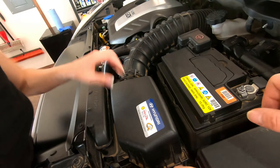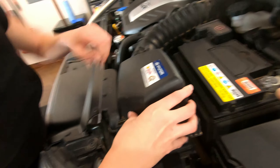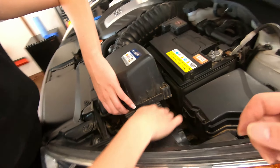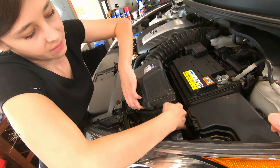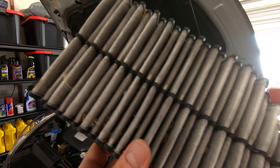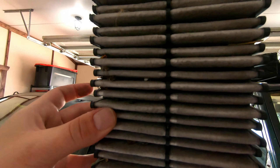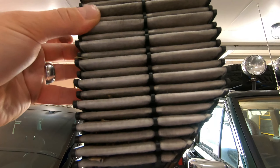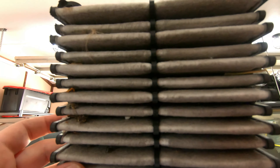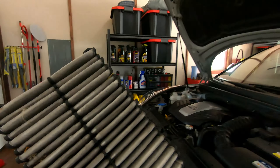Kayla's already underway — she recognized that the air goes through this hose. This is the air box, some clips came off, and you can just pull that up and get the filter out. You can see there's a ton of debris in there. A professional mechanic like my brother likes to hold it up — if you can see daylight through the filter, we barely can. There's pretty much nothing. It's definitely time to change this. Let's compare it to the new filter.